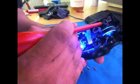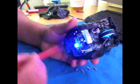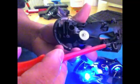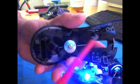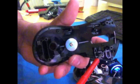As you can see, on your left you'll see a bunch of white shavings that came off from the plastic. So what you want to do is just get a Q-tip and clean it up — you'll see a bunch of muck all around the edge, like dead skin and debris. Clean all that off and blow it out. Here's the problem right here — these little tabs. There are two little flat tabs on both sides when you left click. The right one is perfectly flush and not worn, but yours will have like a little U-notch inside the tab. What happens is when you click down, it's not pressing the button properly — it's not clicking it.